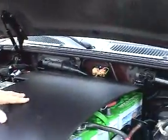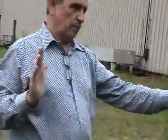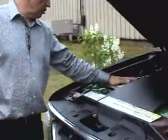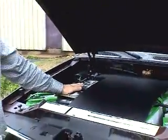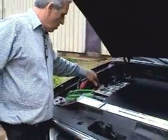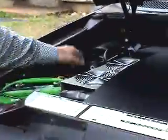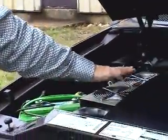This is a little hard to see because the battery bank is on top and the electric motor is underneath. The motor is about this big around. It is run by this controller here — this is the brains of the electric car. It takes 336 volts DC, fed directly from the batteries into the controller.